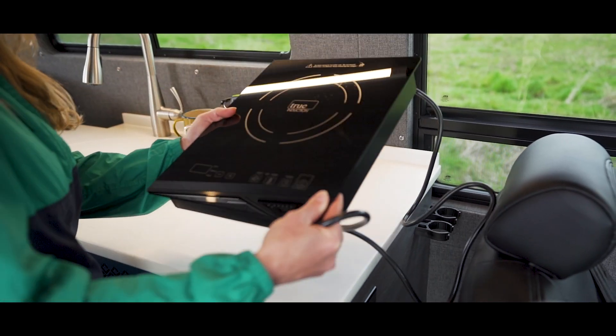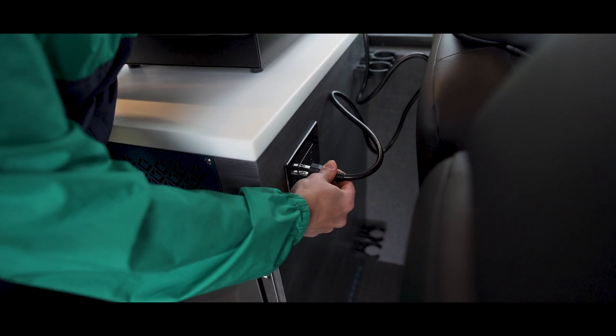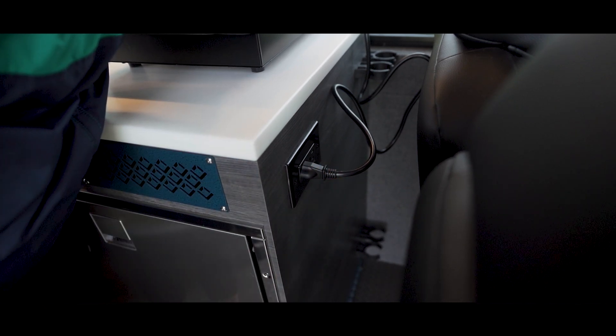It's best to remember that to maximize your battery's life, you should keep them as close to fully charged as possible. When you partially charge AGM batteries with time, they will lose the ability to charge to full capacity.